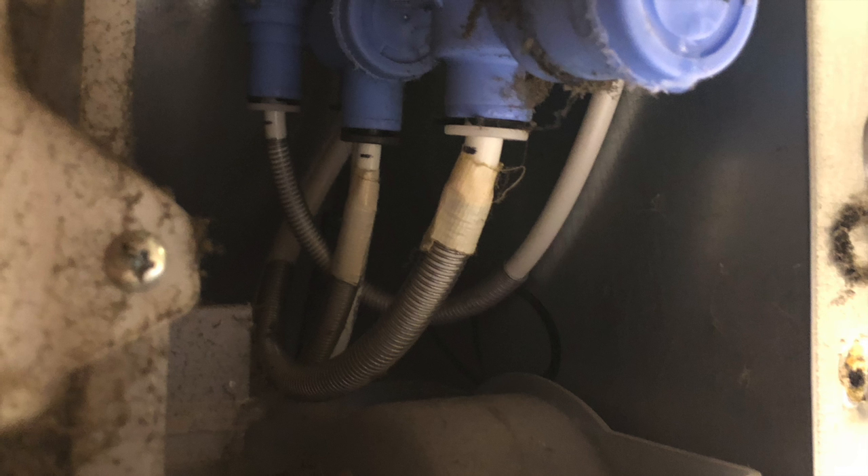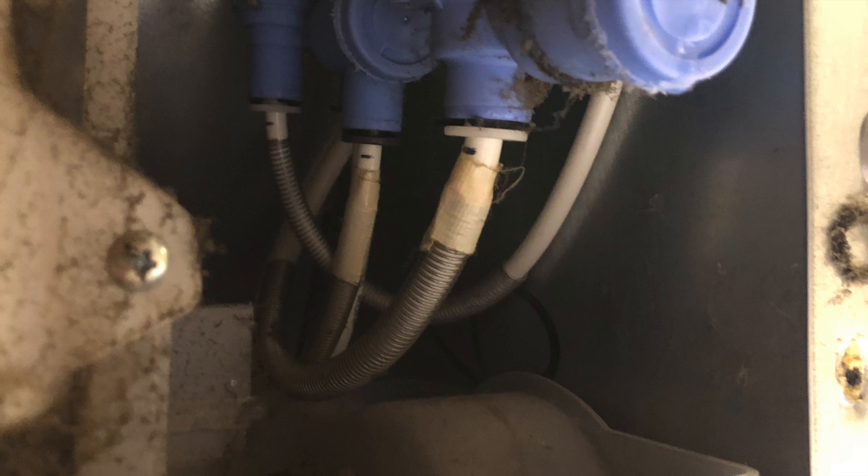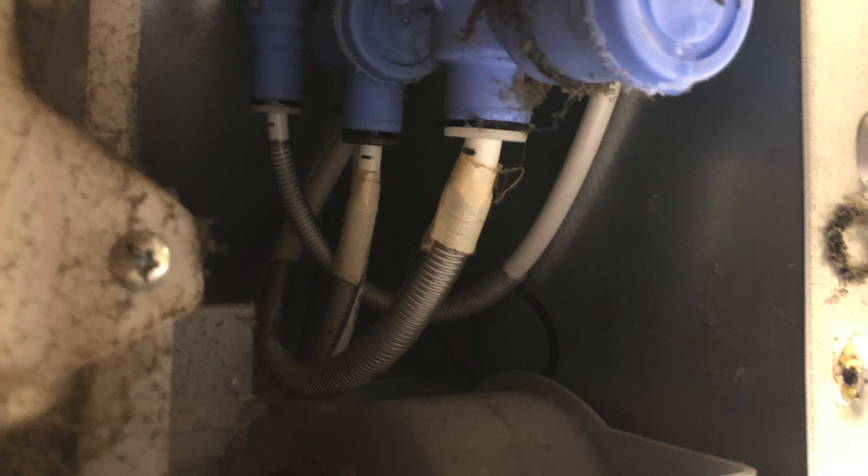The next one is the return line from the water filter, and then that return line gets split into two - the one on the left going to the ice maker and the one on the right going to the water dispenser. This might vary based on your model, so take some pictures and pay attention to where the hoses are going. In my case there were two different sizes, which made it kind of easy to put it back together. If you look closely where the hoses are plugging in, there are little black retaining clips. To remove these, pop them out with a flathead screwdriver or grab them with needle nose pliers - they're C-shaped, so grab them on the closed side and pull. Then depress that little lip washer-looking thing and the hose should just pull straight out.